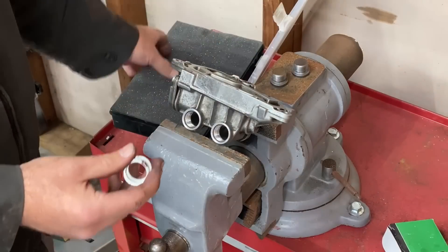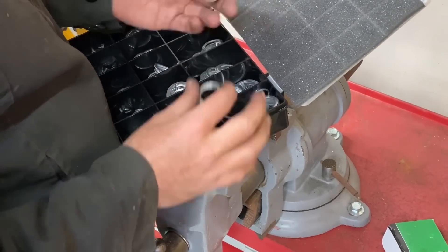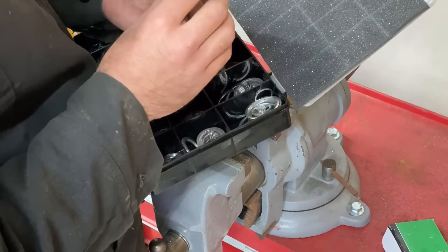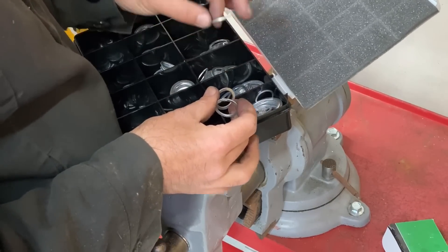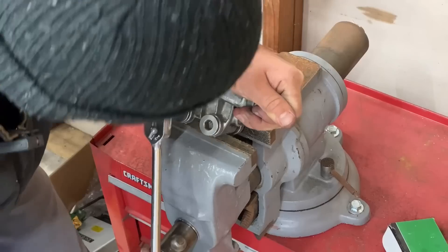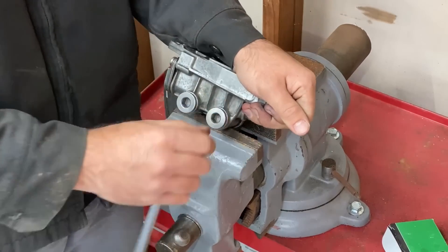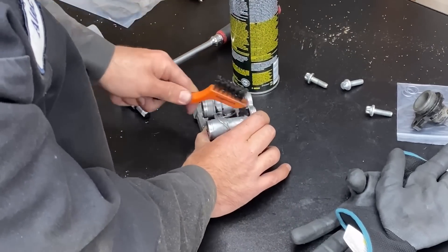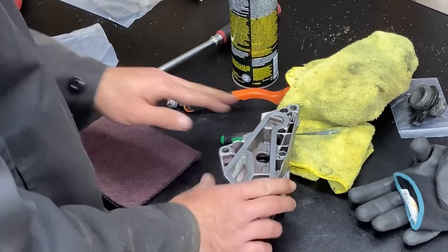Now I'm putting the plugs back into the bottom of the oil cooler. These plugs don't have to come out if you're just doing an oil filter housing reseal, but they were removed. I've got my handy sealing washer kit — I'll link one in the description, it's so nice to have on hand so I never have to leave the shop. As long as you've got the same inside diameter you're good to go. The outside diameter can vary a little bit, but it's really nice to have these aluminum sealing washer sets.